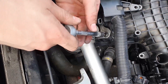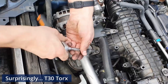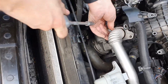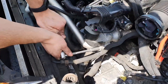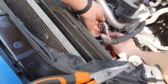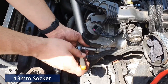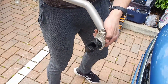Now we can move on to removing the EGR to manifold pipe. On one side it is held by a T30 Torx screw and on the other side by 13mm hex nuts. So that's how the pipe looks - to be fair I was expecting worse.